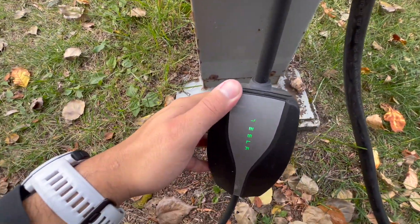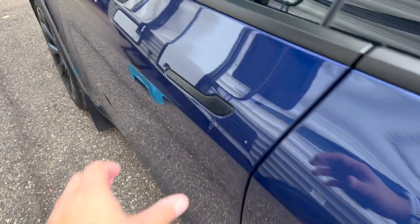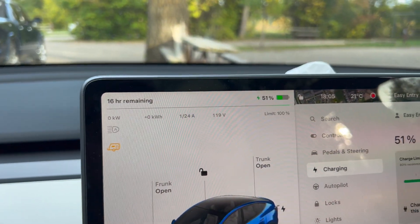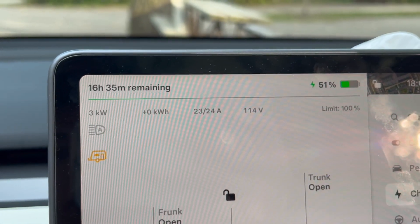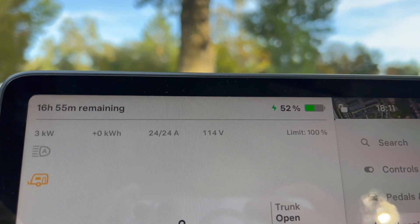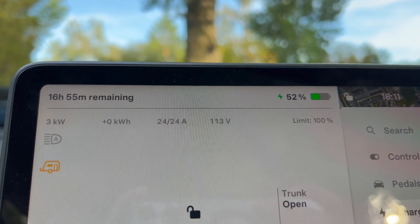It's powered on. Let's go see the car — yes, it's charging. We're getting 120 volts for the TT30, and like I said, it'll be 24 amps on the 30-amp breaker. After about 10 minutes it actually dropped down to about 113-114 volts and leveled off. Thanks for watching guys!